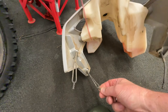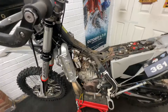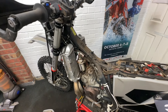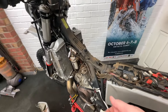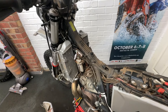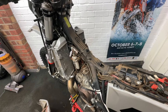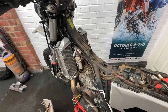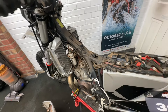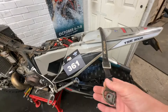It's quite a simple setup. If you're out riding and you need to change a spark plug, what more do you want — just undoing one bolt, a pair of pliers to get the fuel pipe off and that's it, you're into it. If you've got five bolts to undo it just makes things more complicated, takes longer, and if you're out in a field somewhere you risk losing screws and washers.